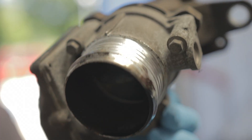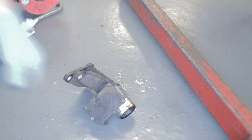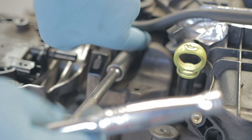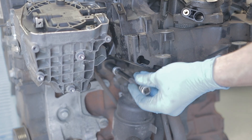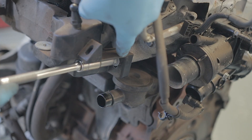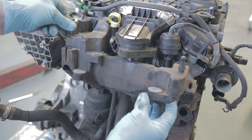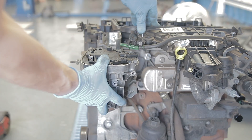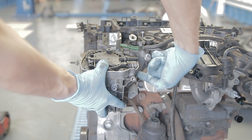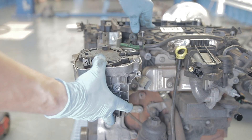I'm not entirely sure but I think Peugeot call this a dozer. A 13mm nut - get that out of the way. There's another 13mm underneath the manifold here, and last but not least a little 10mm. This whole plastic moulding should now come clean out the way. I didn't pull this fuel filter housing off earlier because the plastic panel was stopping it - but now that plastic panel's gone, the whole fuel filter housing assembly will come clean out the way.